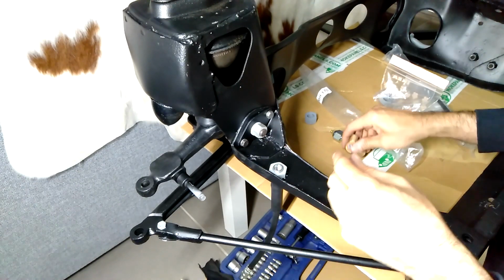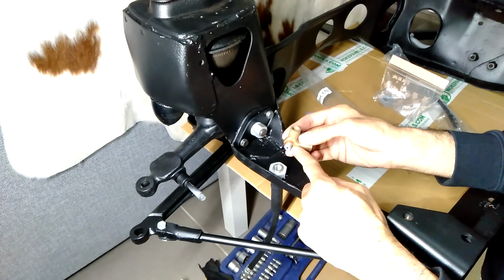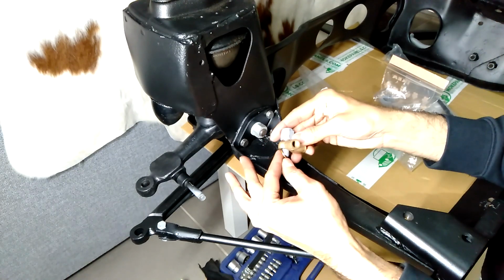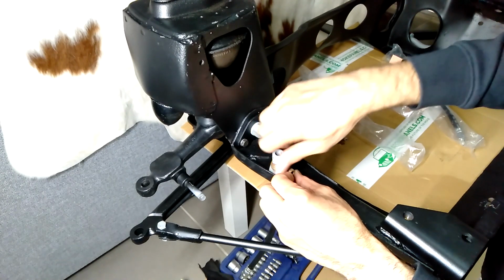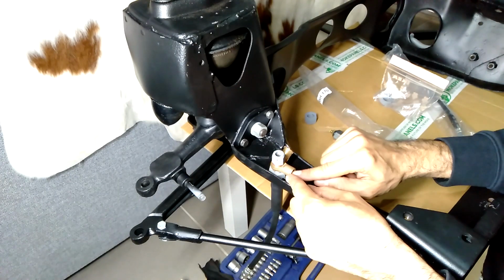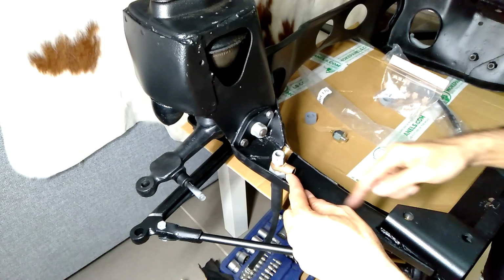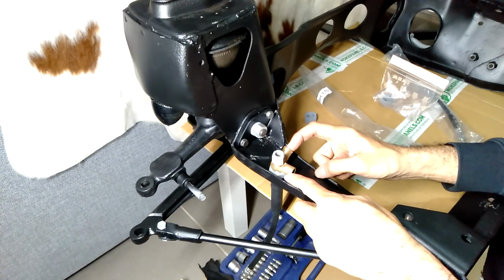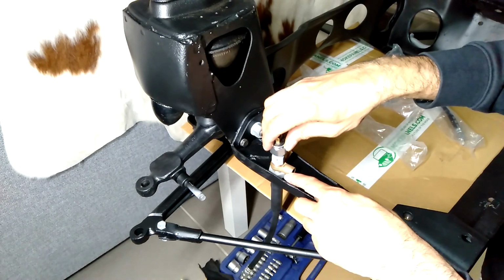Okay, then next we would place this whole structure on there. There's a copper washer there. Each side of that there is a copper washer. So then that will wind in. Then this side here, that outlet will go to the left-hand side. The brake line will just continue around the subframe. That comes up from the T connector after the master cylinder. And then of course this brake switch screws into the top.